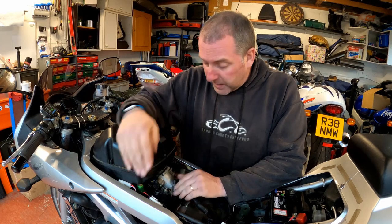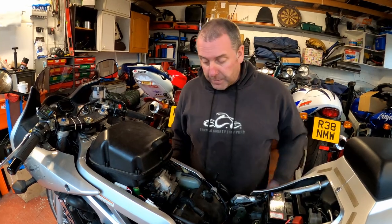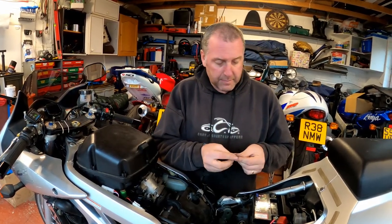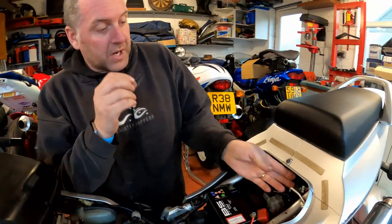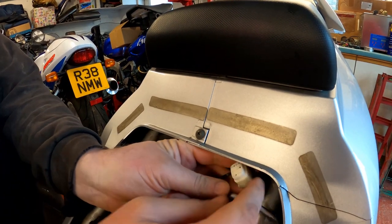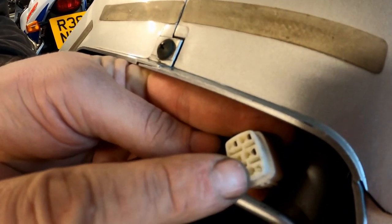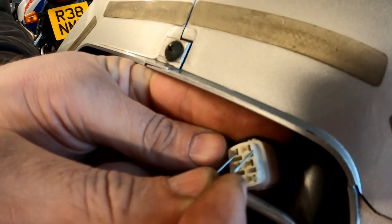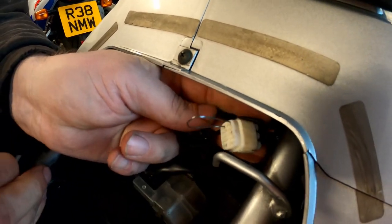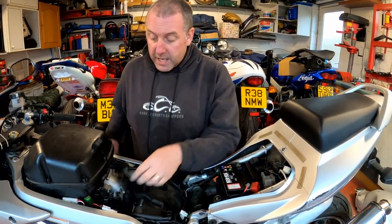This is what we're going to adjust in order to bring that dash on the dashboard into the center of the display. In order to do this we first need to put the bike into dealer mode, and to do that I have my little paperclip. Here's the socket as we've done before. Pop the little black cap off, and the two pins we're bridging are the two at this end — the opposite end from the blank pin. Simply put the paperclip in and push her home.